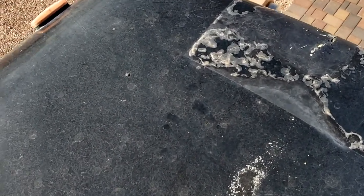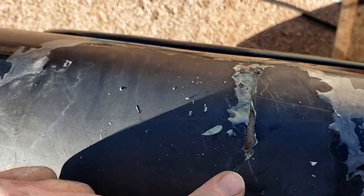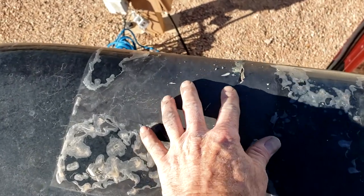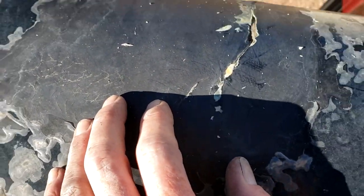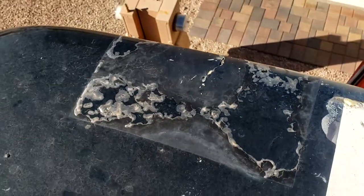You can see peeling clear — that's pretty common. Checking is pretty common too. But right there you can see a big crack all the way down. This would be the rear cap and this would be the roof, and this is where they body-worked it together. That bodywork failed — you can even see filler in there.